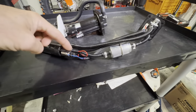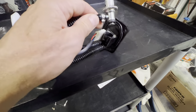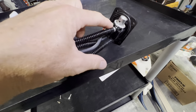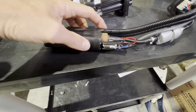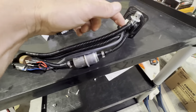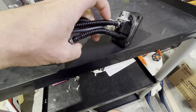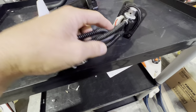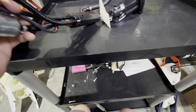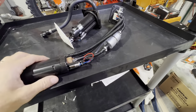You've got your wiring here. This is the inline fuel filter. As the pressurized fuel comes out, it goes up into this blending area — this is the regulator. This fuel regulator holds pressure at 49 to 51 psi. Any reject pressure then goes back through this line, goes into the assembly right here, and then cools the pump motor via this relief hose. This is the outlet port. The high-pressure return bleed-off goes back into here, and then this connects to the through pipe that goes out to your fuel injector.